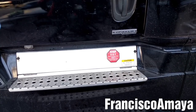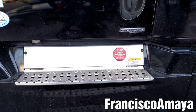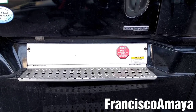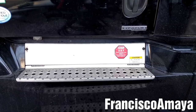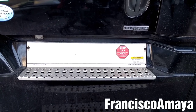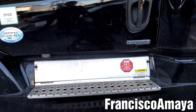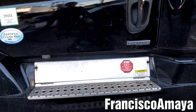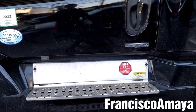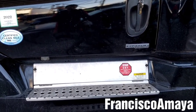This is all I'm going to show you about the DEF filter replacement on a Cascadia. This process is going to be a little different for older Cascadias because the filter has a smaller housing, but the basics are very similar. It is located in the same area in a different position. Now after the DEF filter replacement, all you have to do is clear the codes or perform a regen depending on the type of codes that you have active, so the codes will go away and you can verify the DEF pressure or whatever DEF problem the truck was having.